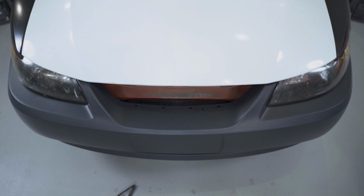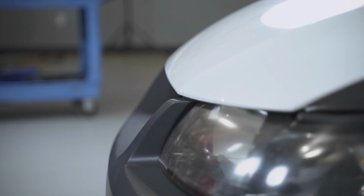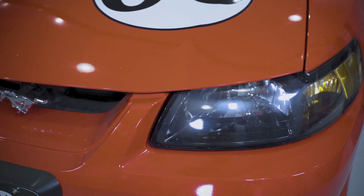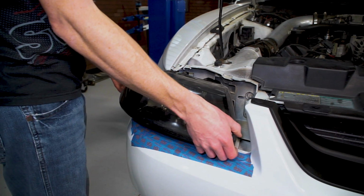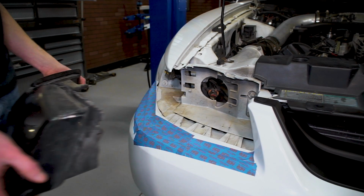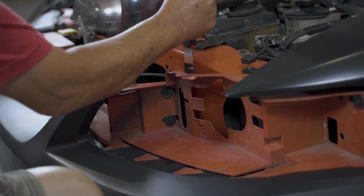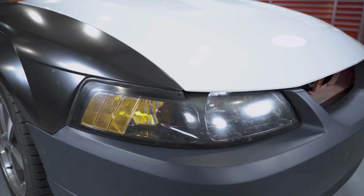the proper gapping needed. Moving to the hood to bumper fitment, this can take some time. Again, going off the measurements from your stock unit will help you out here. Removal of the headlights will be necessary as well to gain access to the header panel and attaching hardware. Again, just doing the initial setup and letting the body shop finalize this one can help.